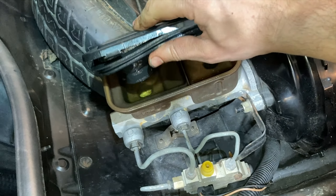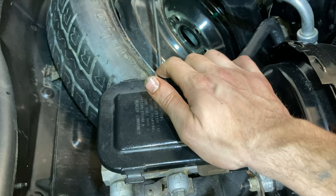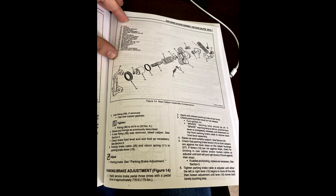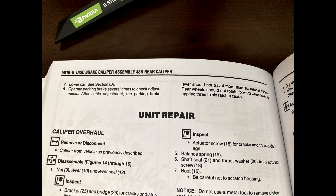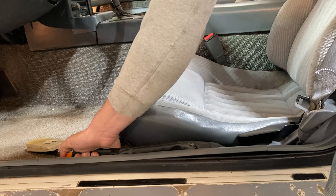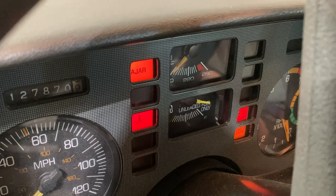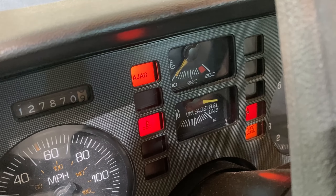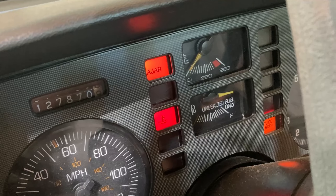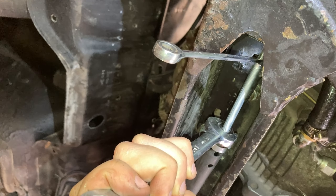Tighten the bleeder screw to nine and a half foot-pounds. Then once you finish up, go ahead and replace the caps on the bleeders — they're really important for keeping it from seizing. Finally, fill up and cap off the brake reservoir for good. Apply force to the brake pedals three times at approximately 175 pounds. Apply the parking brake at least three times. Make sure it's been fully released by turning the ignition on and ensuring that the brake light does not show up. You may have to pull down on the parking brake lever to ensure slack is in the system. Check to make sure both parking brake levers are on the stops on the back of the calipers.